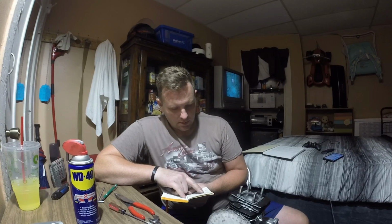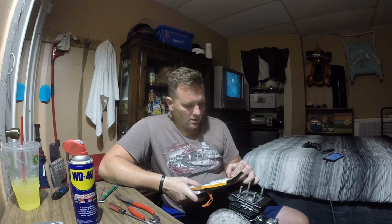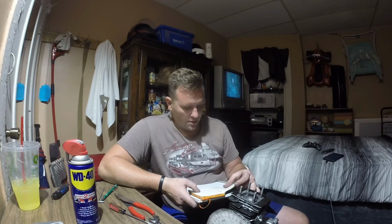Okay. So the intake was 60 in the other motor, on a different bottom end, it was 62, the same cylinder. It opened at 62, closed at 62, was 124 degrees of duration. On this bottom end, it is 136 degrees of duration.